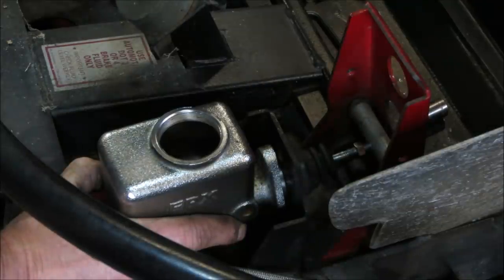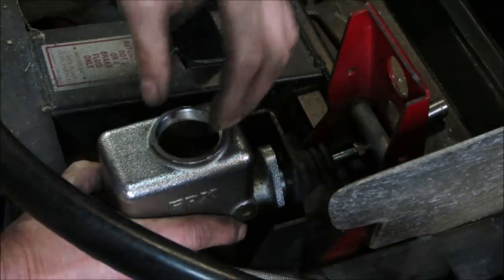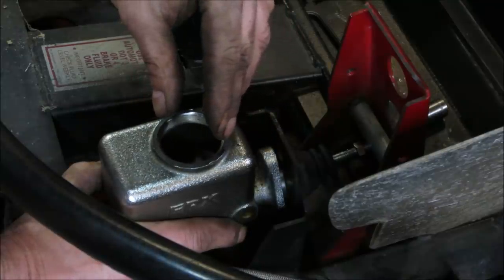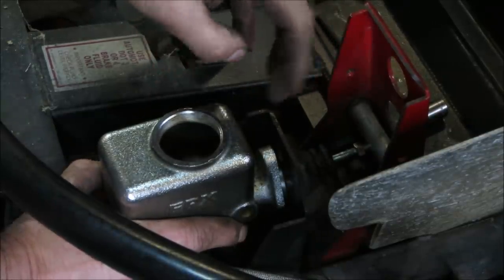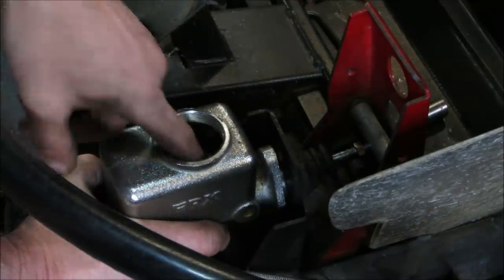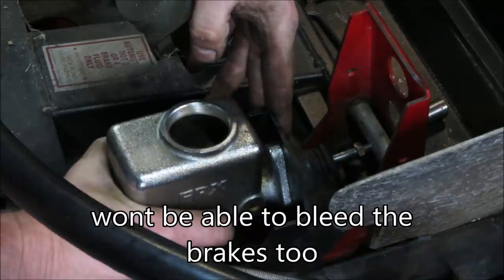A lot of people make the adjustment to try to make their brake pedal higher, and what happens if they get a slight leak, or as brake pads wear, the caliper piston gets further out, and it uses fluid that just stays behind it to take up the excess space. Well, once that excess fluid gets used up, your pedal would go to the floor. Nothing ever replenishes it because the pedal never comes back enough for the fluid to drop down in the hole. So that would be the issue there.